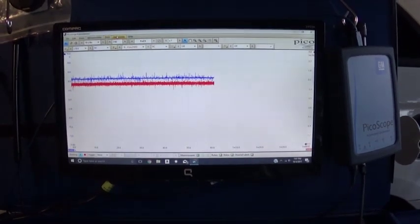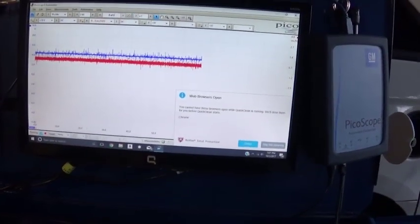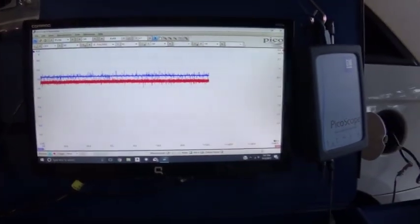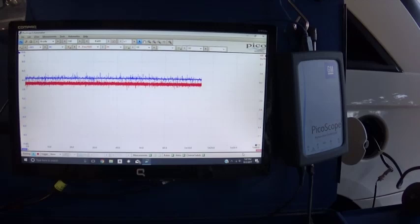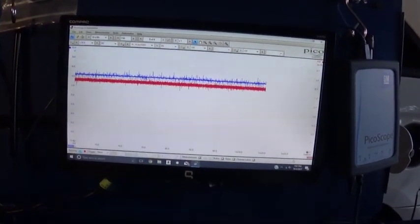Basically it works off of 4.5 volts. It's a pull down design, and it will close once the pressure inside the EVAP reaches 1 inch of water. I'm going to make another video explaining in detail how that works, but right now I have to figure out what's going on with this one.